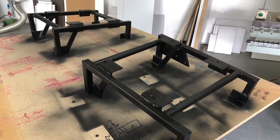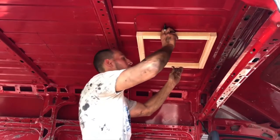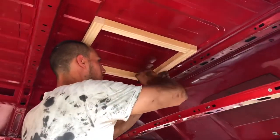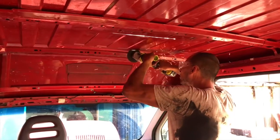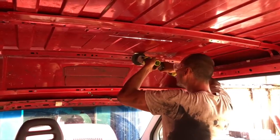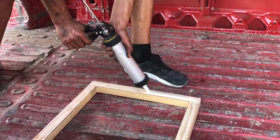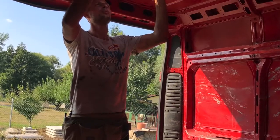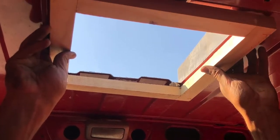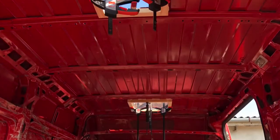That was a fun project and an opportunity to practice welding for me. Next are windows or roof windows — let's do all the main things right at the beginning. Decide where you want them and cut holes for them. Next I made a simple wooden frame to even up the thickness of the entire roof. The window clamps together like a sandwich and for a proper fit it needs solid support. Make sure the top part of a roof window or side windows is properly sealed.